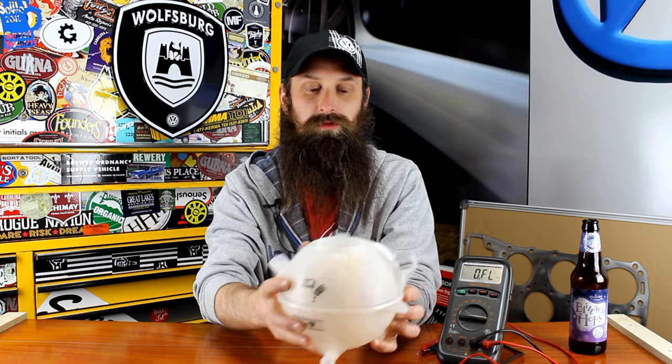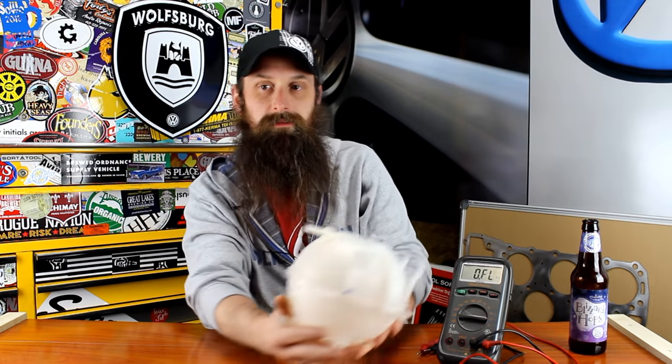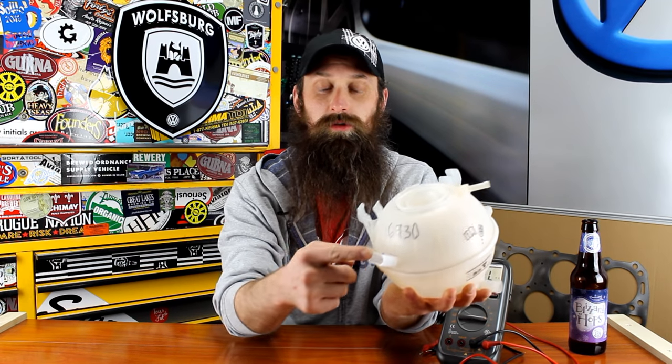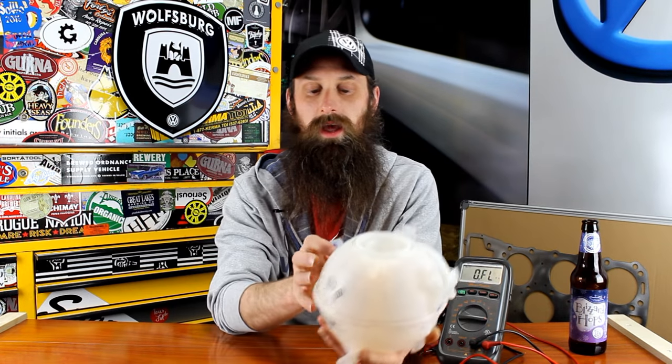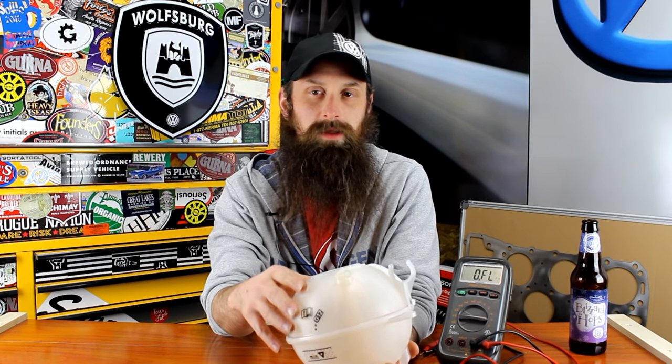This one actually has wire looms — that's what this is right here. The harness wraps around the back of it. So it's simple but does a lot more than you would think just a little plastic ball would do. There are two contacts inside the bottle that go to this connection, and then from here two wires come out monitored by the instrument cluster. When the coolant level drops below the two contacts, that's when the little red light will come on.